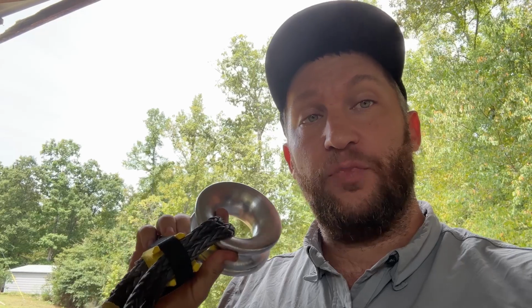So Brennan's Garage ring failed in every aspect of the product. It came in last place at a 22.7% frictional loss, while Yankum Ropes, which is a worse design in my opinion and damages your winch line, had a better performance. So an anodized ring is more slippery than a non-anodized one. It also failed in the weight test. It came in second to last place.